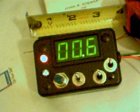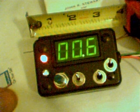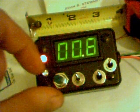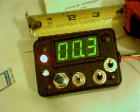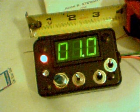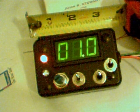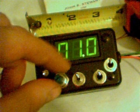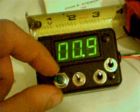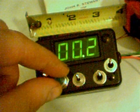The adjustment is this pot right here. The voltage is oscillating at a certain rate — both the voltages themselves and the rate were fairly critical to figure out. When adjusting, what you're looking for is the highest voltage during the oscillation. Right now it's at one volt, so that one-volt setting is what the ECM sees. That would make the ECM think the engine is running very rich, and it would adjust to run lean. Turning it down, whatever the highest voltage reads is your setting — so at 0.9, then 0.8, and so on.